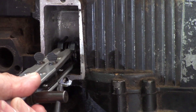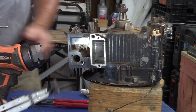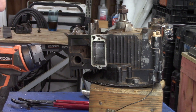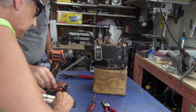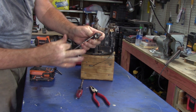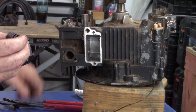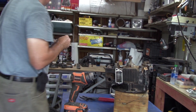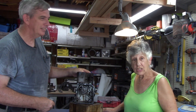See the exhaust valve is sticking out — look at that, there you go. How easy was that! Now you want to keep the exhaust valve with the same spring that it had and the same retainer. Open it up like this and keep them together — you don't want to mix springs and retainers with other valves. Wonderful — congratulations, we'll catch you on the next one.